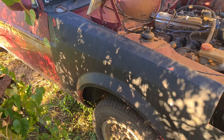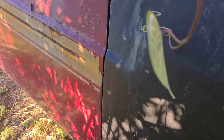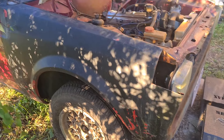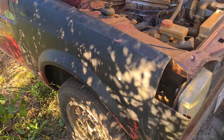I've replaced this whole front panel. The guards I actually built in the middle of the Queensland desert — you can't get hold of Escort guards, so I grafted a set of Ford Laser ones on. I cut them right around the edges; you can kind of tell just by the join up the side, but I roughly grafted them on over the top. It did look alright when first done and it passed roadworthy here in Queensland.